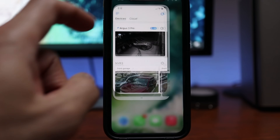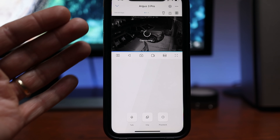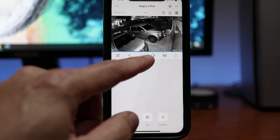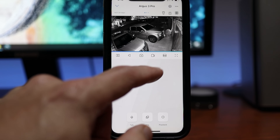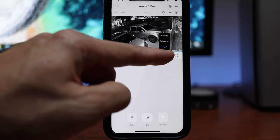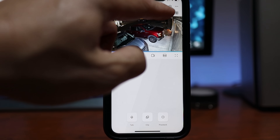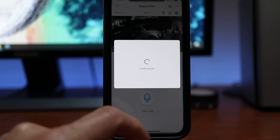Time to check out the settings in the app. In the main app page you will see the camera, and clicking on it you will get to live view, which depending on your connection can load up quick but most of the time is a bit delayed. In here you can pause the live view, mute the speaker, click the camera icon to take a snapshot saved to your phone's album, or the video icon to record the live view also saved to your phone's album. You can change the video quality of the live view from fluent, balanced, and full 4 megapixel or 2K resolution. There's an expand icon for full view. On top we have the spotlight icon to turn on the camera spotlights which also changes to full color. And a siren button to manually trigger the alarm. At the bottom we can start two-way talk which is full duplex.